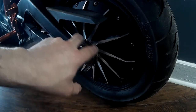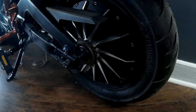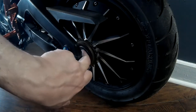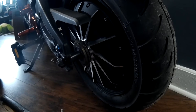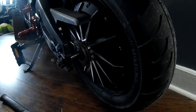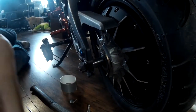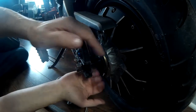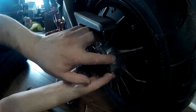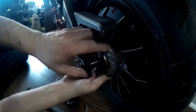Once those fingers are removed, I'm going to put it so the little freewheel goes both directions and I can put the chain back on. First, what we're going to do is take that off. We're going to have to tape it up before we do that. The tape doesn't have to be that nice — it's basically just going to keep it from falling out and all the bearings in the back falling out as well. So as long as it's tight, it should be good.